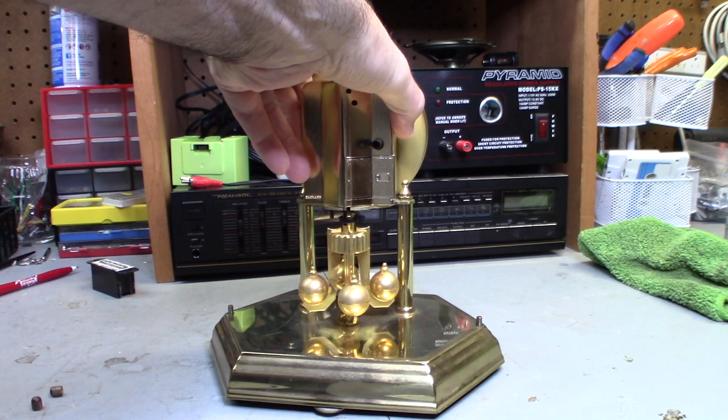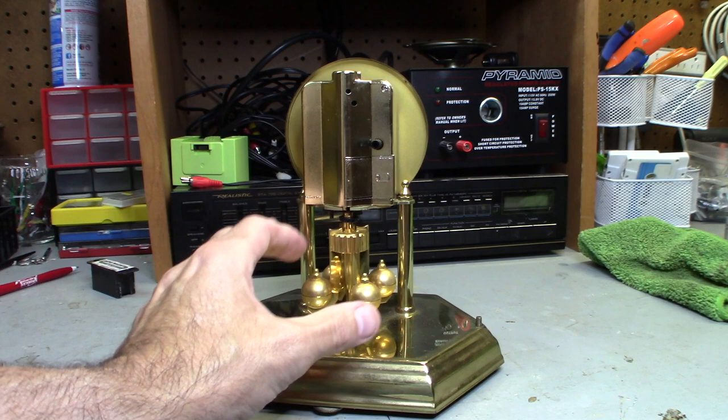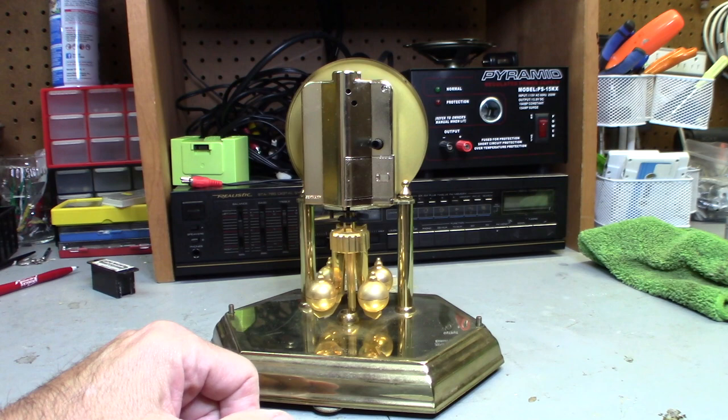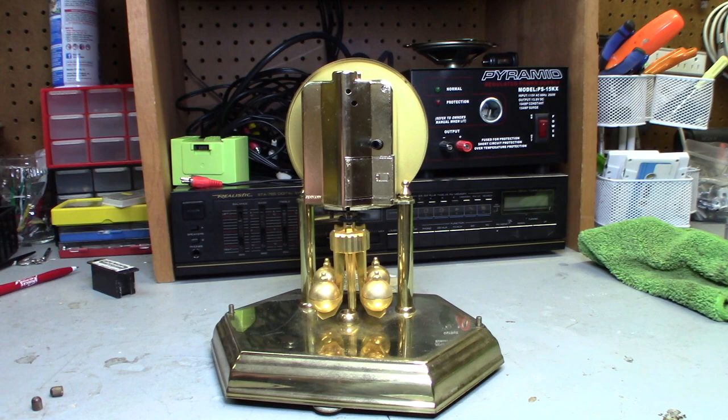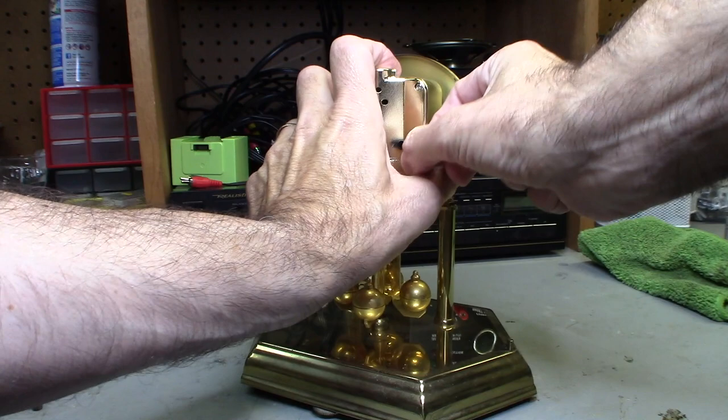Let's look at the back of the clock. The main thing about these clocks — as long as this is hanging and it's pivoting correctly, a lot of times it'll be broken, they'll fall off, they'll snap. There's a shaft in here that's plastic, and if that shaft is broken, that's almost impossible to repair because it's hard to find these pieces. But if it's hanging there and it seems to be moving okay, most likely it's just a battery connection issue, and a lot of people don't realize that.